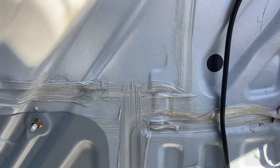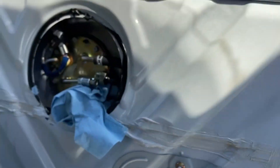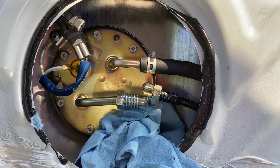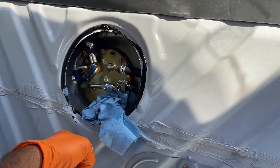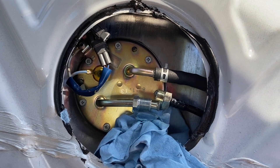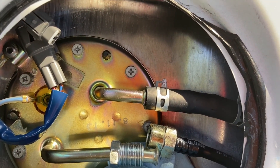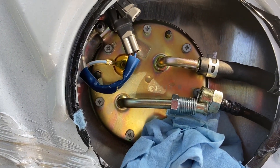So when you're inside the car, the tank for this vehicle is inside the trunk, so the last thing you want to do is spill gas. Now that I knew there was no more fuel in the line, this is — I think it's a 19-millimeter. 19-millimeter, 14-millimeter — this connection is insane. Doing this without breaking something is almost a miracle. What I found to help: I got my 14 on this one and held it down here, stood up on my knees without banging my head into the roof, and pushed down on the 19-millimeter one as I kind of pulled up with the other one, trying to keep all force rotational and not directional. Then you've got to jimmy that hard plastic line and do it the rest of the way with your fingers. Then that one just comes out — I believe that's a return line — that should just come right off easy peasy. Then there's a bunch of Phillips or 8-millimeter screws, and we're going to take those out and dive into what's wrong with it.